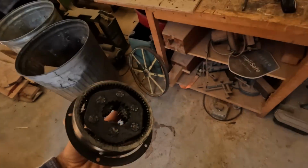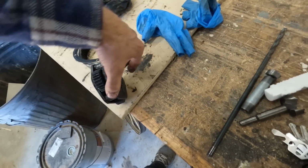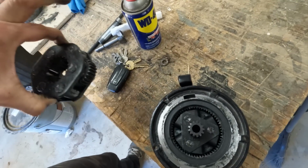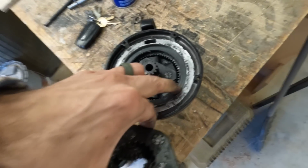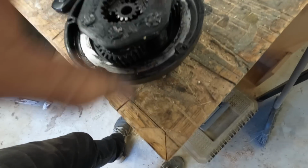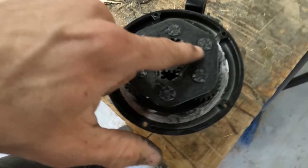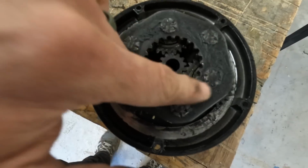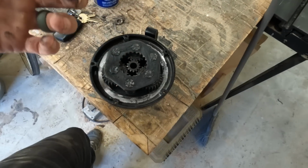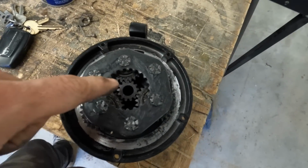Okay, we'll just take everything. I've taken this thing apart, put it back together a million times, and when you take it apart, you want to take the whole side, not just this case. So generally I have the whole piece. So that's the little piece of plastic there. This sun gear sits on top, and kind of rides on it. And you can see these gears right here. You can see some wear, kind of some shininess on those. Those are what drive the spool and turns the cable and pulls the cable. That's where the slipping is happening.